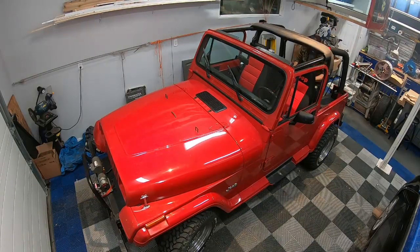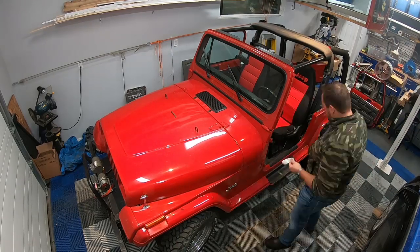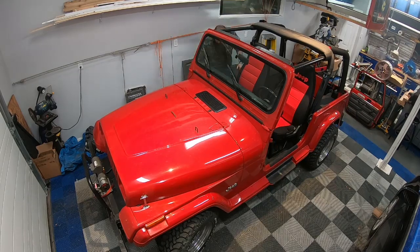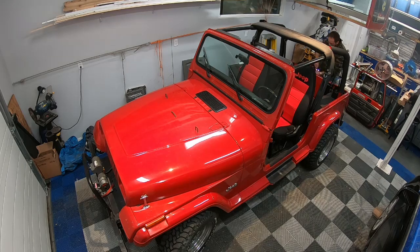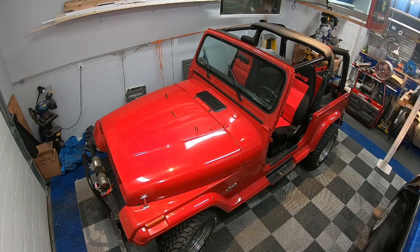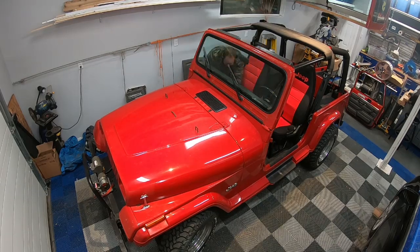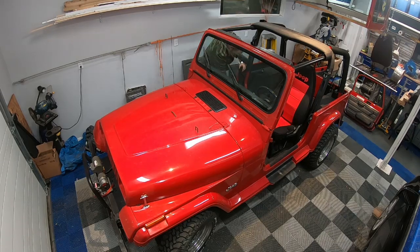Jumping right into things, wasting no time — pulling out the back seat and either of the doors. Removing the spare tire carrier on the back of the Jeep and then moving the passenger seat. There are a lot of Torx bolts in here, so you're going to want a lot of Torx sockets for this type of work. These had been out before in my Jeep, so it wasn't too bad, but in a lot of cases they could be rusted in — PB Blaster could be your friend.